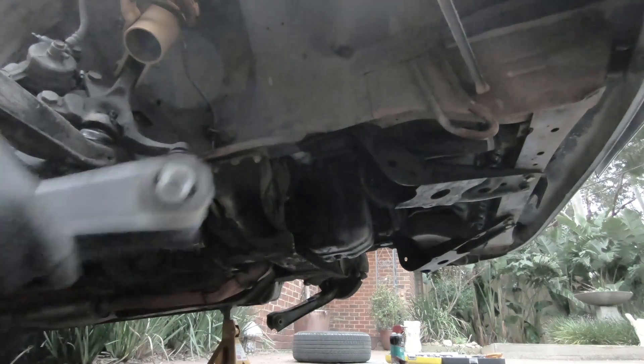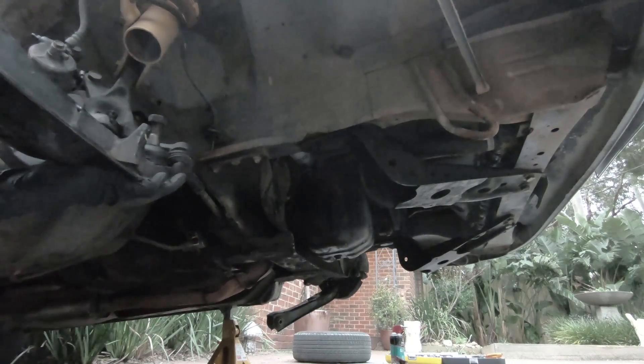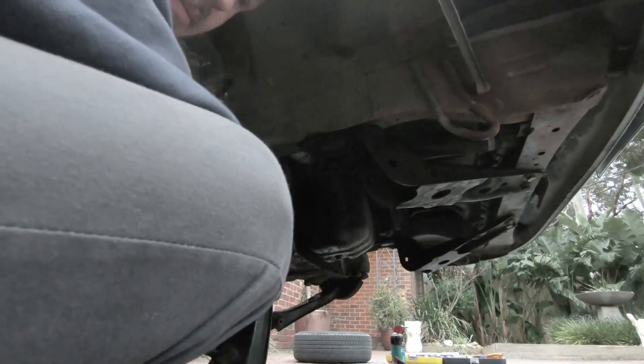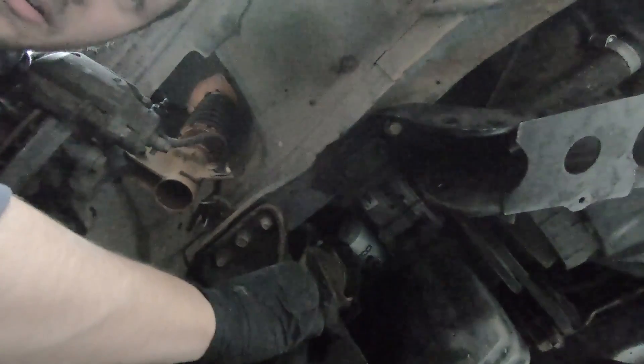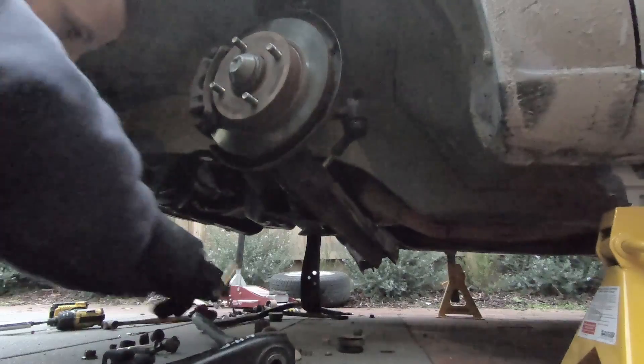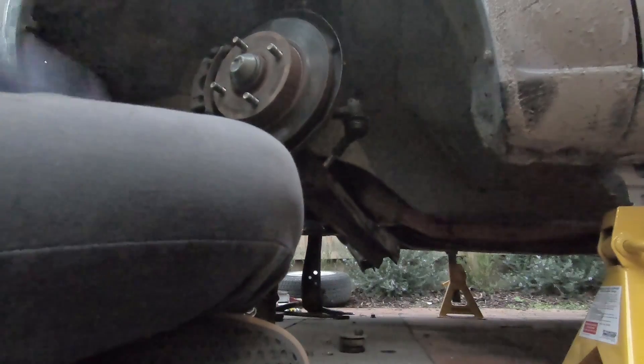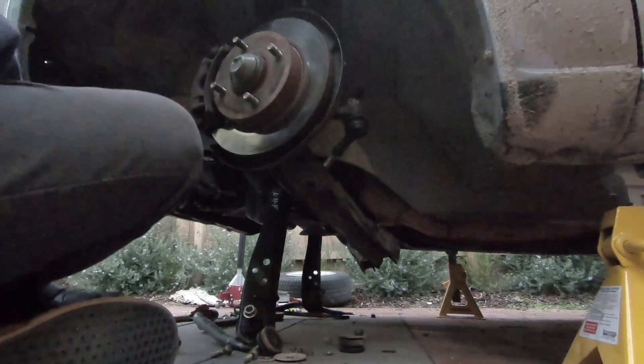I came to give it a go and fix these issues nonetheless, because these issues suck. I can put the base of the lower control arms in — the new ones. Because of the knuckles the wheel already pokes out a fair bit, and these actually sit a bit further out again — they're a little bit longer. I can't properly tighten these yet because I need a 22mm spanner, and I'm not going to tighten it with my shifter. Take out those ones, chuck in the new ones. That's looking good — obviously not tightened yet because other stuff has to come out. But we're getting closer.